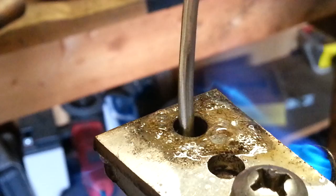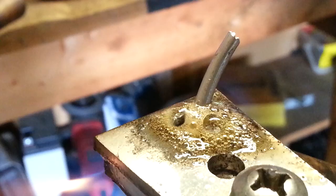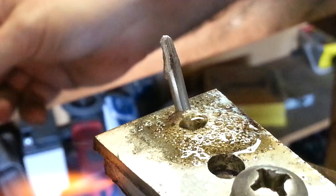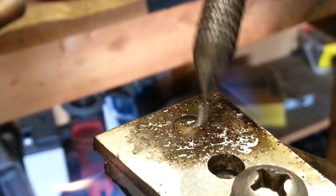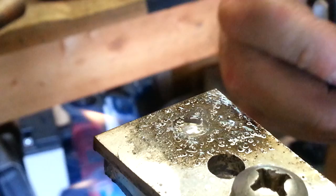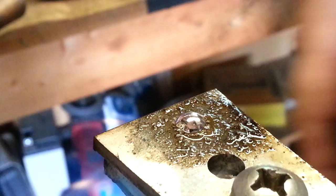I'm going to start touching the solder into the pool to see if it's ready to melt — it's not yet, so we're just going to keep heating it. There it goes, slowly but surely. Now we're going to fill this cavity with solder, continuing to heat it until it bubbles. See it's got a nice shine to it, so we know it's heated up well.